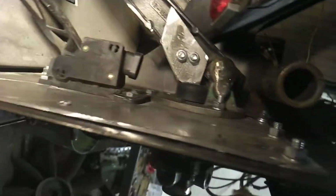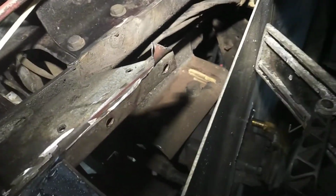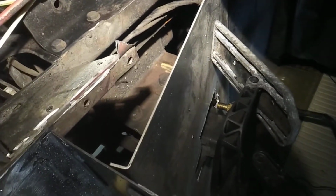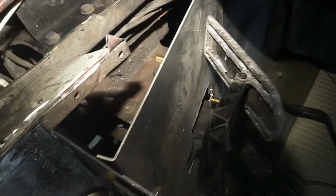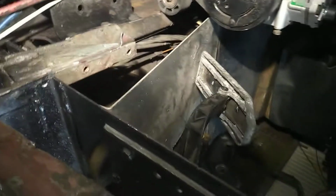Yeah, I've got to seam seal that, and that'll make it a lot quieter in the cab, a lot neater. Nothing poking through the floor. I pulled all the wires and connections and whatnot out from underneath the floor. There was a bus bar there, and a shunt for the ammeter, and the valves for the chassis heat were under there, which was dumb because you've got to crawl on your back trying to figure out what's what. So I moved all that out from under.